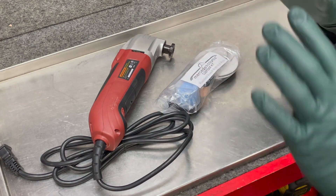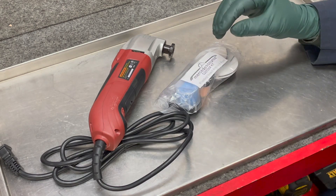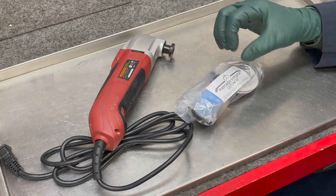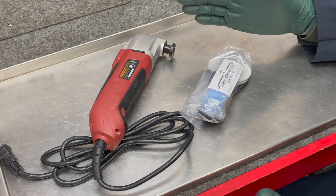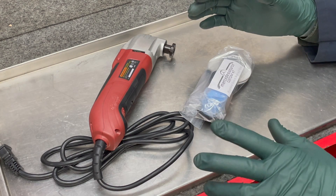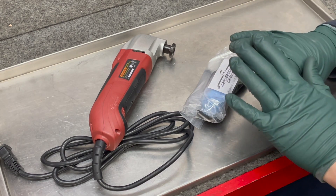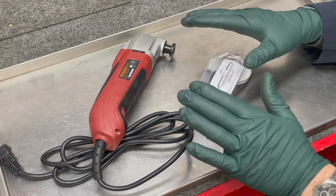That's one of the reasons why I covered the car with plastic. You get this compound down in vent holes, on your wiper blades — you'll spend a half hour cleaning it all off because this is kind of a messy operation. Number three, the reason I prefer the multi-tool: it doesn't overheat the glass like a disc will, and this is something you have to be real careful about. If you get the glass hot, you can affect the lamination and have a problem, and then your windshield will have to be replaced. So using the multi-tool gives you those three advantages.